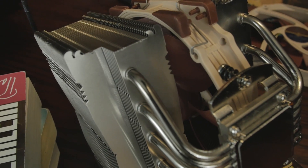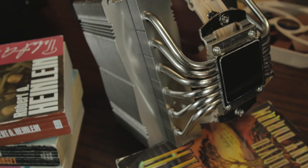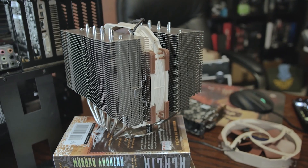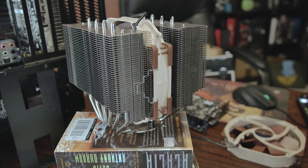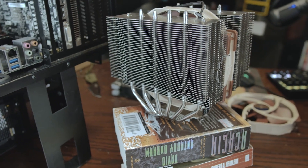Now let's talk about noise. It's around 34–35 decibels at idle — I place the decibel meter right on the table. Under full load it's 39 decibels, which is less than leaves rustling. I was curious how loud it would get at 100% fan speed and it hit 42 decibels. But it rarely runs at 100% — it generally runs at 60–80% under full load, even with the overclock.